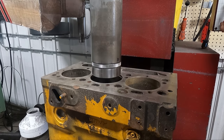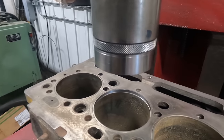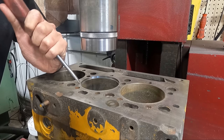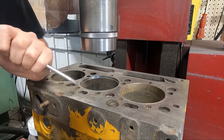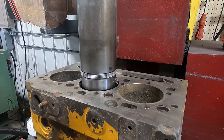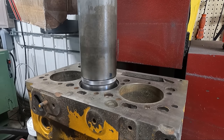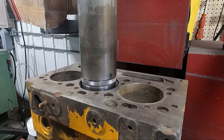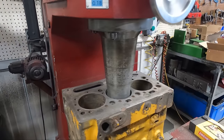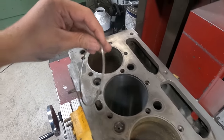These sleeves are flanged, meaning the top of the block has a counter bore where a larger-diameter step of the sleeve seats at the top. Before letting the cutter run all the way through, it never hurts to stop the machine just below this flange and make sure that we aren't cutting into the parent bore of the block. At this point everything looked set correctly, so I went ahead and broke off that upper flange and proceeded boring through the rest of the sleeve. Yes, I have seen comments suggesting a sleeve puller or running a bead of weld down the sleeve, but in our shop we've seen too many blocks damaged by people attempting those techniques and failing.